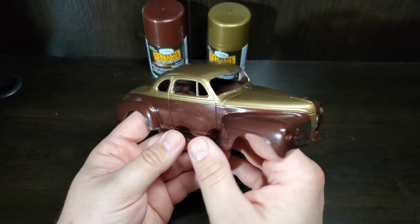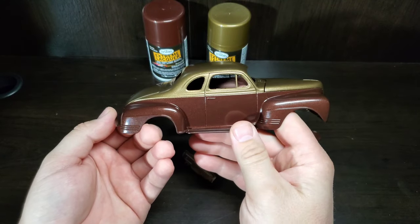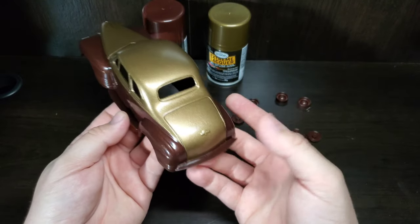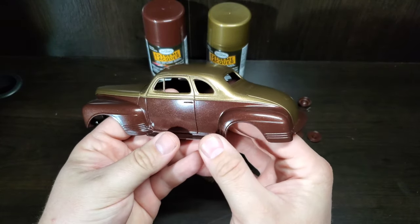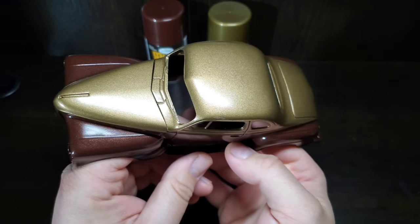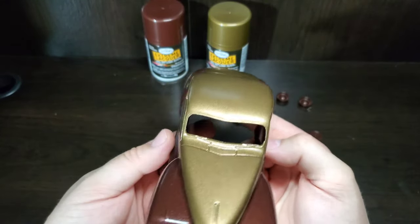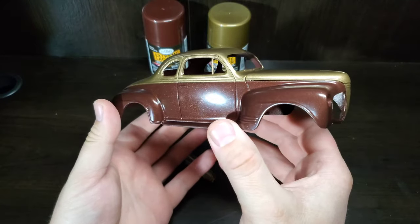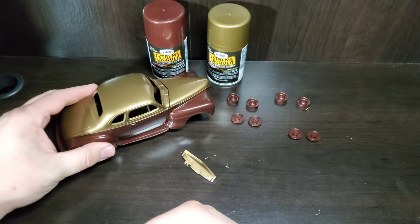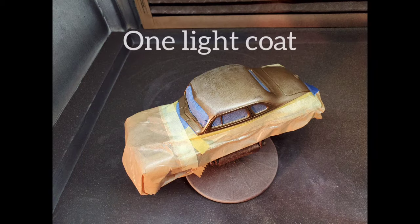I think this tutorial was good enough to get you through your paint jobs. Again, number one problem with painting is just too heavy or too quick in between coats. With lacquers, just take your time - they dry quick anyways. Give it 5-10 minutes between light coats and we got a decent shine. It's ultra flat, no big orange peel, no dry sprays - just a nice, consistent finish. If you follow all the steps and take your time, you can come up with the same kind of paint job yourself. Thanks for watching.